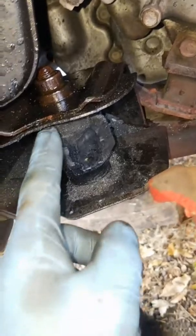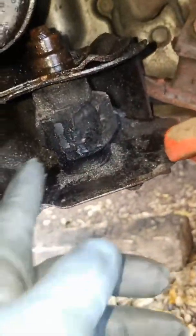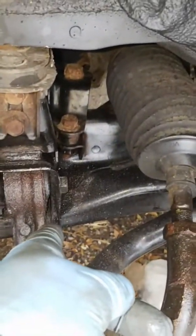Another side, we're still working on cutting the knuckle. We cut that side. I'm working on cutting this side, and then I'm cutting this one too. I cut the bottom halfway. Just gotta cut the top. I'm doing this because I'm gonna cut right here and then down at the bottom, and that will let the bolt fall with this piece, and then I could just turn this. Alright, and on this side, you gotta come in from the bottom with the blade facing up.